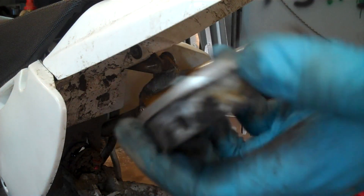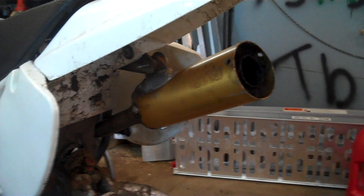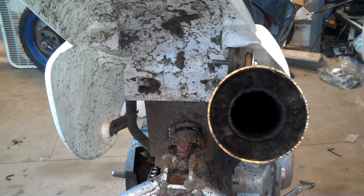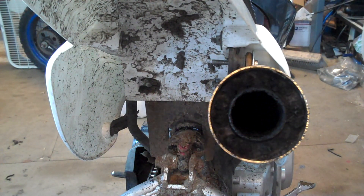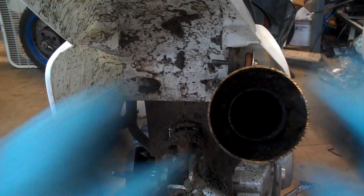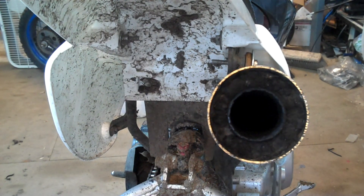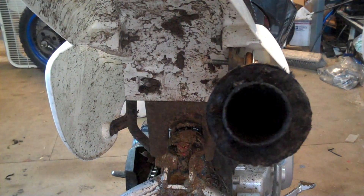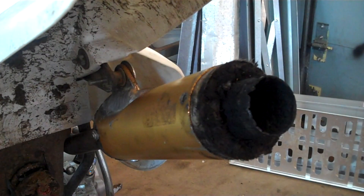So now that you have your end cap out, set that aside and set your screwdriver aside. This is your exhaust packing and core right there. What you're going to want to do is — definitely with gloves — reach in, use a thumb and an index finger or a pair of pliers, and just pry it up. I'm going to grab a pair of pliers and try to work it out that way because I don't want to risk cutting my fingers. Just gently work it out and it's going to pop out; now just keep on sliding it up.